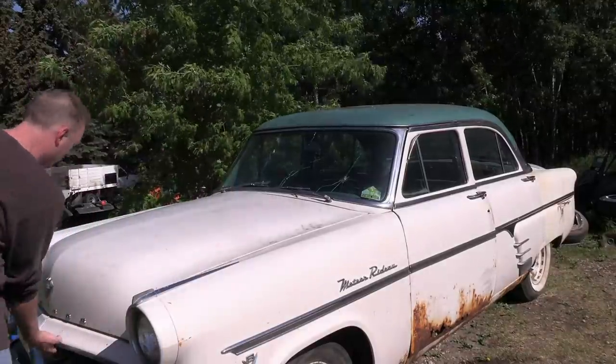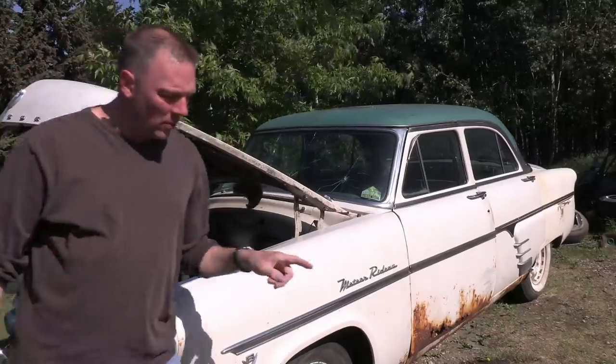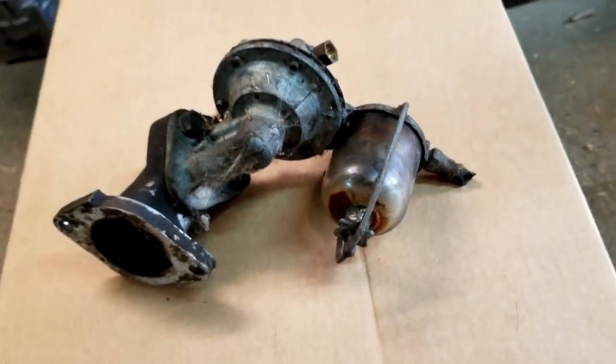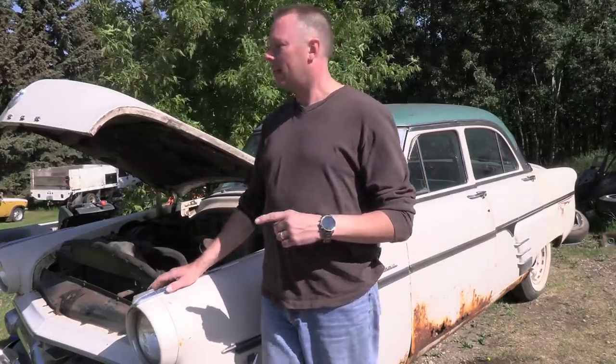It's been a couple days. We had lots of rain, so I had to rush in and out of the garage working on this car. I have done a few things off-camera. Pop the hood — the fuel tank was not gravity-feeding properly, so I looked at the factory fuel pump on the engine. I put a vacuum gauge on it and it was actually trying to draw fuel.